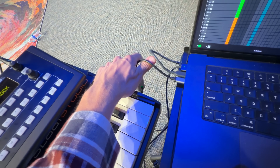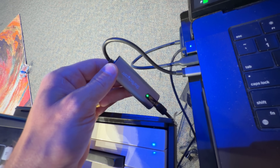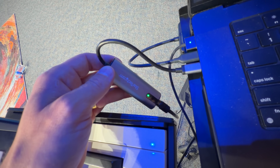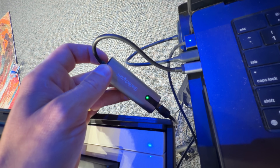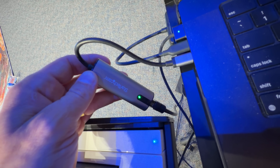The next essential component has to do with the network infrastructure we integrated at this church. We are using Dante audio networking, so rather than needing physical audio interfaces like a Scarlett plugged in over USB, I'm using one USB-C to Ethernet connection — the StarTech adapter. It's really important to have the right NIC for Dante because it doesn't play well with all adapters. This one we've tested a lot and it works really well.